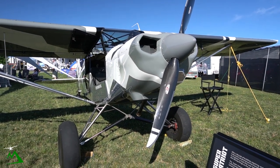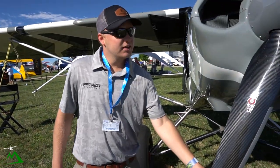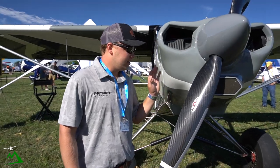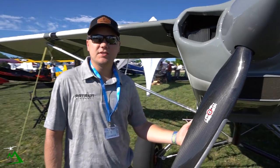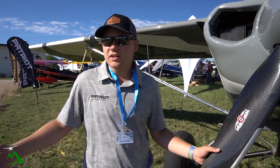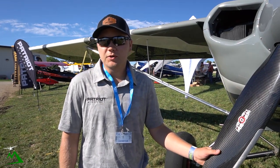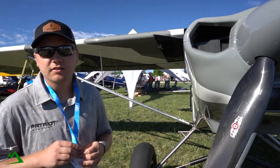This engine — I was a little skeptical about running an IO-320 — but this little engine gets it. That's about the same as like a 172S or something like that. Is this ground adjustable? Yes, and this is kind of what makes the airplane. You can pitch it for climb or pitch it for cruise. You pitch it and take off at 70 feet, or if you need to get somewhere quick, put it on the number 10 setting and you're going 110 to 112 miles an hour.